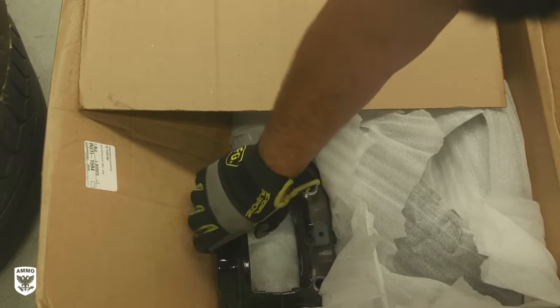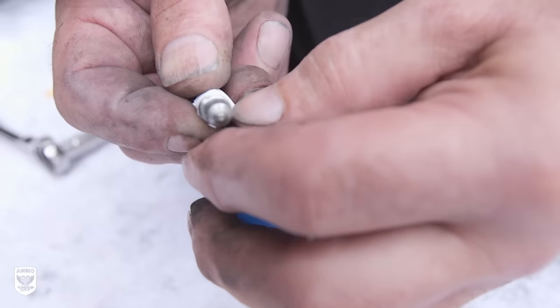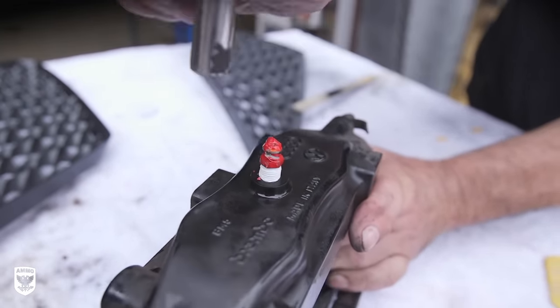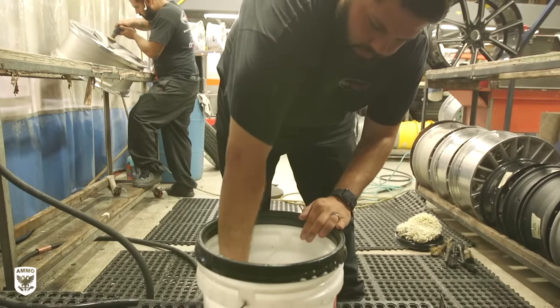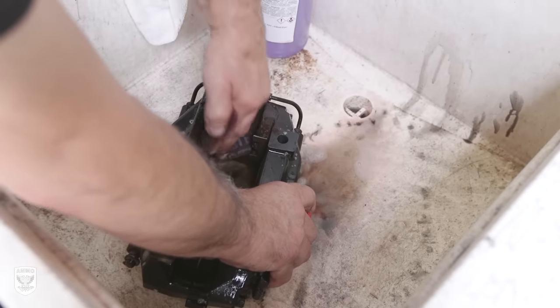While that was in the works, the calipers were unwrapped from SST Auto, and a special welded brake bleeder valve is tightened into the threads to prevent any water or paint from getting in and the remaining brake fluid from coming out. Next, they were immediately cleaned in a special degreaser to remove the first layer of junk, then thoroughly washed with a scrub pad to remove the embedded brake dust.